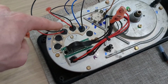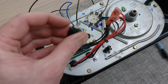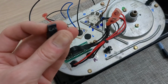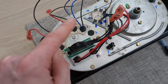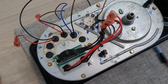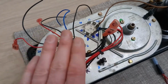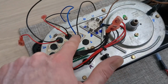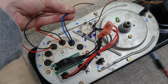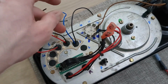A black wire goes onto that, providing 12 volt, in this case, to all the lights on the top side of the light. And on the back side where the wires came in, those were actually the grounds to the light. So the DC current flowed in reverse on those lights. Now that I've moved everything, they're all just on isolated LED circuits, which have a positive and negative wire coming out of them, obviously. So it really doesn't matter now.